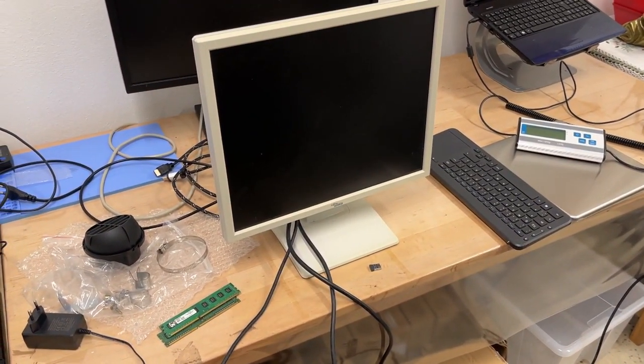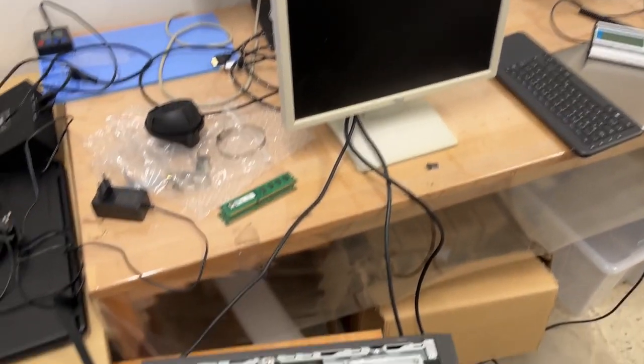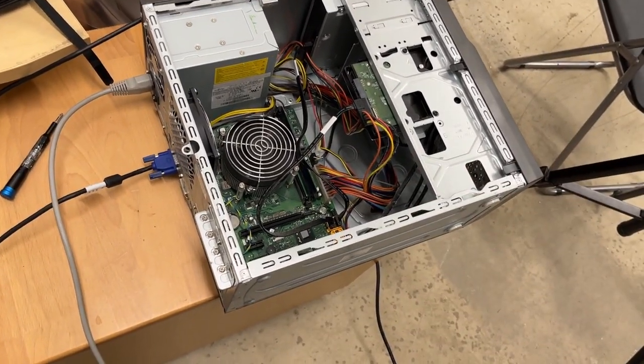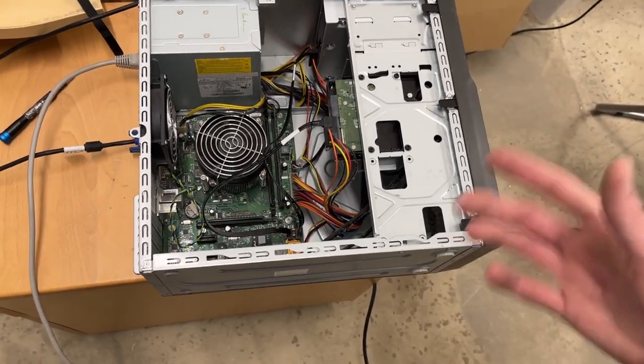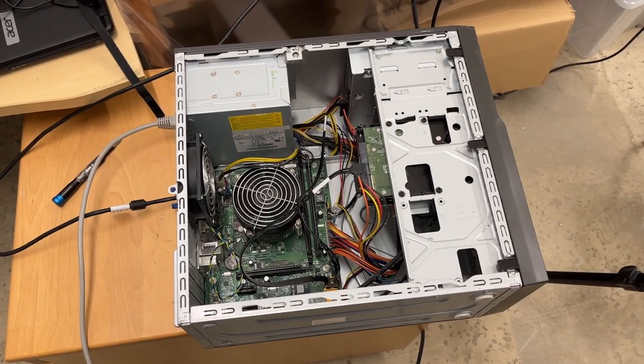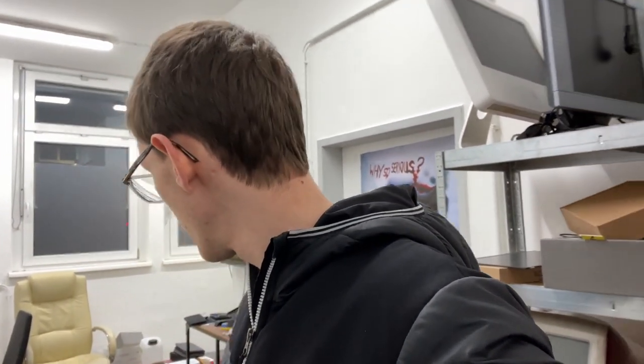That's it. Yeah. So it's not the RAM, it's not really the processor, like it could be, but it's very unlikely. So probably it is the board. Oh well. So I just tried quickly with another power supply, just ruling that out as well, and still didn't work. So yes, I'd say 7 out of 8 computers working.